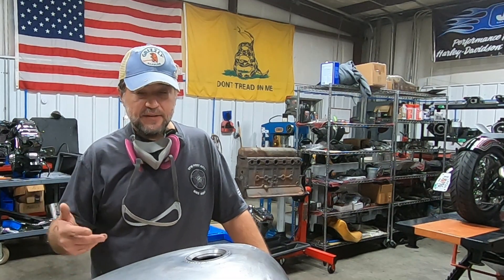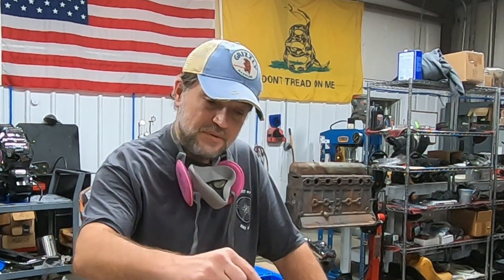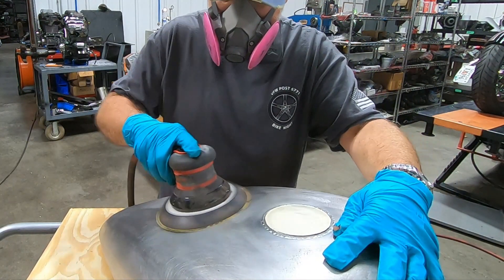Now we move to the outside of the tank and how to remove the rust there. This one was rusted up badly enough that I decided to bead blast it. You could use sandpaper, but that could take a while on a tank this bad. Before putting it in the bead blaster, use your rubber plugs again to plug all the holes and tape the inside openings thoroughly so you won't get any sand inside. After bead blasting I also pulled out sandpaper — the manufacturer whose epoxy primer I'm using recommends a 180 to 220 sanded finish, and it's appropriate for direct metal application.